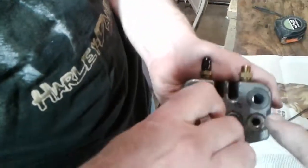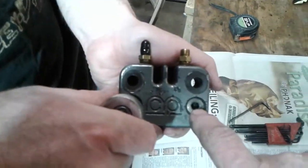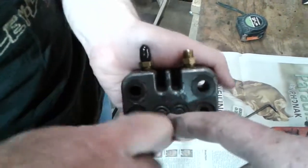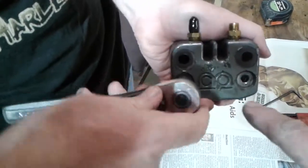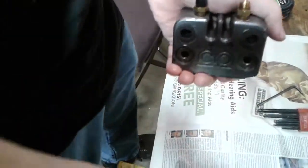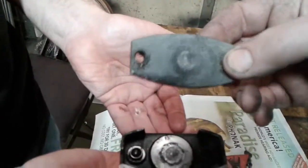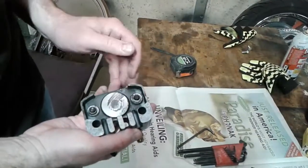Okay, in the center of each one of these adjusters is a 3/16 Allen wrench, and you reach in there, and he's using a ratchet with a 3/16 on it, and he's taking that loose. That'll be loose by now. Unscrew the other one. Brake pad drops out of there. You can see the holes in it where it threads in. Those come through the center of those adjusters.